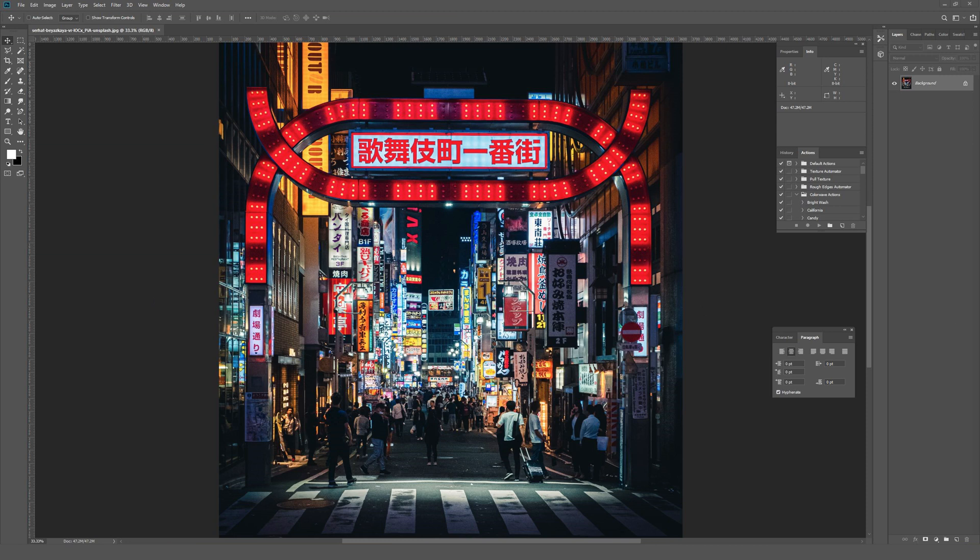On Amazon the Pro version is currently $169, which isn't terrible — roughly what I paid for the Spyder 4 Pro back when I bought that. If you're looking to get better color accuracy or just make sure your monitors are in a decent spot for your eyes and for getting the best images on whatever monitors you have, this is a great way to do it. And if you had a monitor that lets you set the Kelvin value — the color range — you could get even more color accurate results, as it would let you set those perfectly rather than simply adjusting brightness, which was the only setting I had to work with.